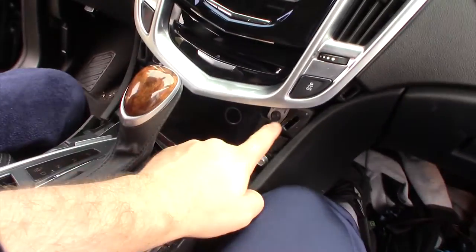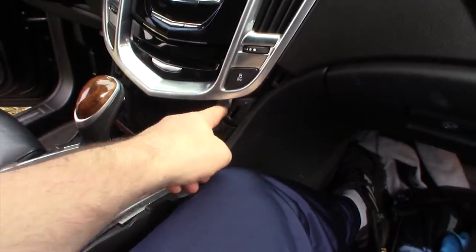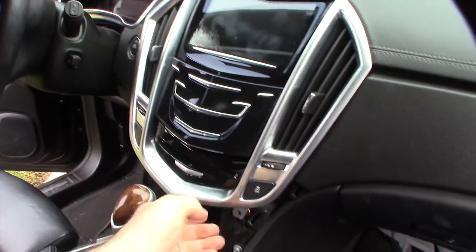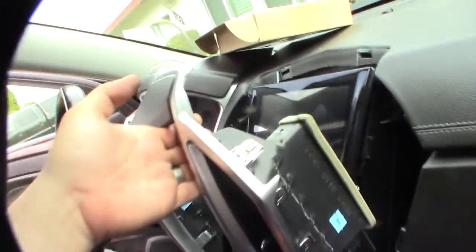The unit pops forward — you lift it forward and up. There should be two screws here and here that pop the top bezel off. There are some spring-loaded clips in there, and as long as you have the two bolts off you should just be able to pull it forward. You need to open this thing up first, then it pops forward at the little clips.